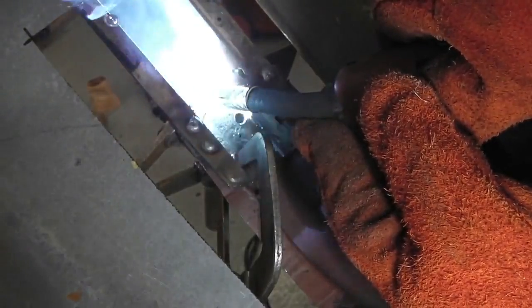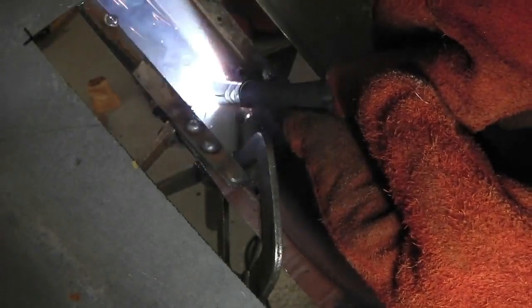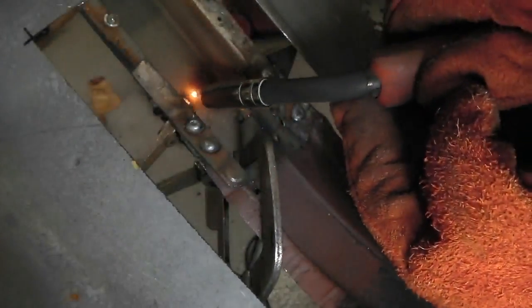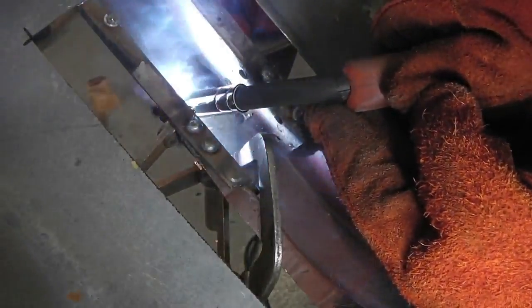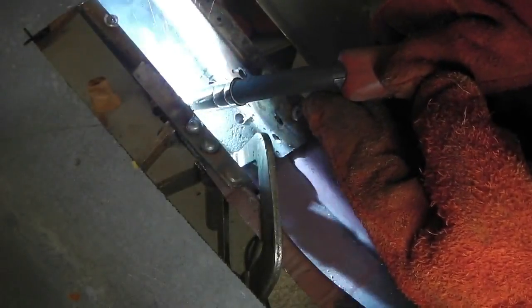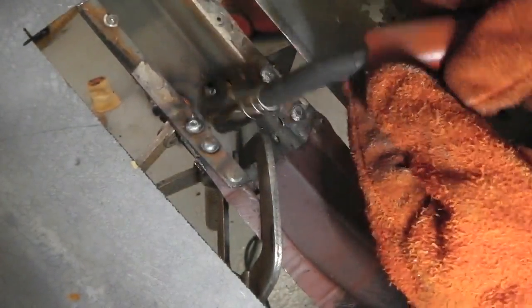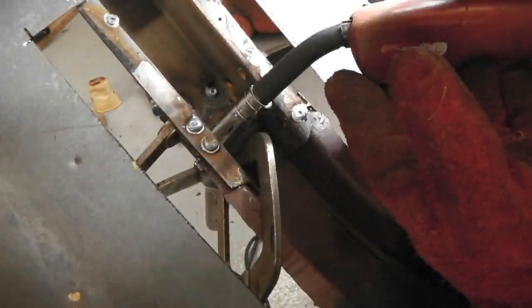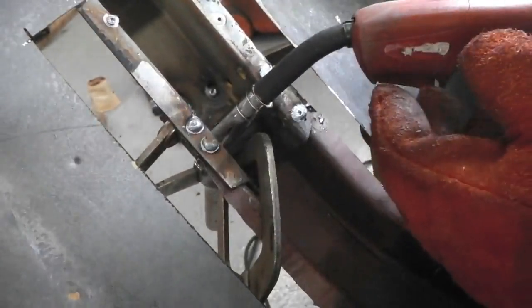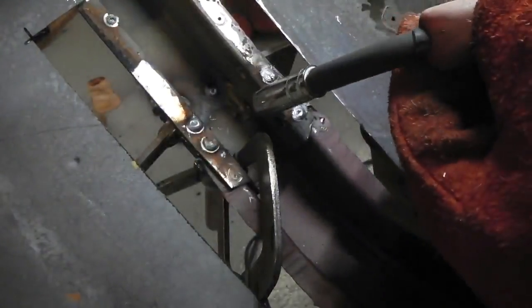You see there's not a lot of burn back on that primer, even the ones, if you look close, next to the weld, and it's still intact, so it's good stuff. I'm going to be going over all the seams anyway with a syringe and some rust killing stuff, some FE123. And I'm also going to Google what other chemicals I can put in there. But all that happens later on. We're just on a welding mission at the moment. We're just really thinking about strength and structure and moving forward into the middle area of the car. If there's an area which I think is going to be boxed away and we're never going to be able to get to again, of course we'll give it some treatment before we close it up. That might apply to the front lower valance panel because it's going to enclose the box section, so I have to remember that. It's got to be well primed in there.